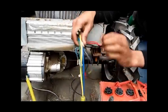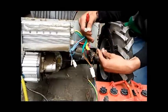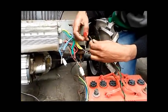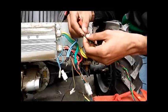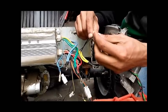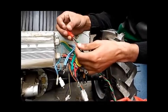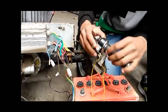Our motor is now connected. The rest of the wires — apart from battery and motor — are very simple. We are left with only three types of wires. Two ports are going to be connected to the throttle. The throttle has the same three colors: black, red, and green. Connect green, red, and black to the corresponding three ports. The black is ground at zero volts, red is positive at five volts, and green is the voltage receiver — varying voltage from zero to five volts varies the motor speed. You will get a female socket and can simply insert it.